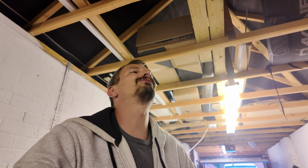New problem. It seems to conk out when you put it in first. Side stand was retracted, so I don't know if it's a dodgy side stand sensor or something.